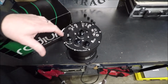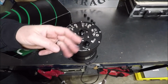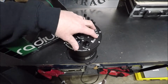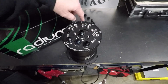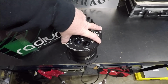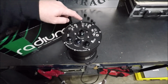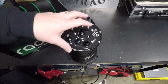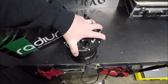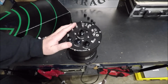Some of the other surge tanks that I was looking at, in addition to not having the central output for up to 3 pumps, the main one I was looking to go with, and the one that had offered me a huge discount, it only had 3 retaining screws for the lid. Now that made me real nervous because we're going to be mounting this in the hatch area. I'll show you where in a minute. But I couldn't help but think to myself, if you've only got 3 retaining screws in this lid, that's really not applying force evenly along the whole circumference of the seal. And I would be really nervous to put that inside the vehicle, in the trunk, the hatch area, anywhere.